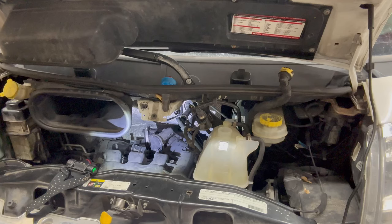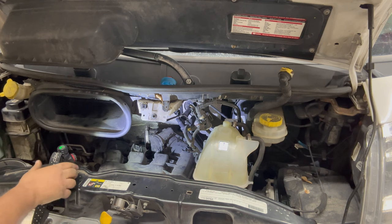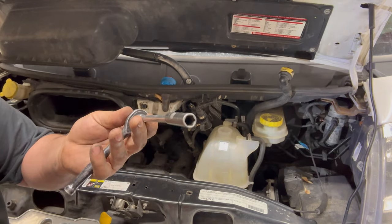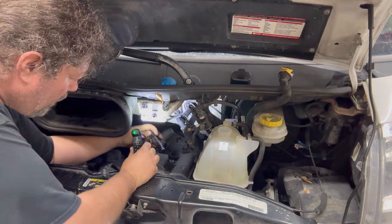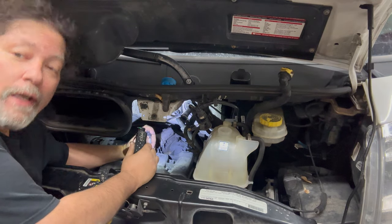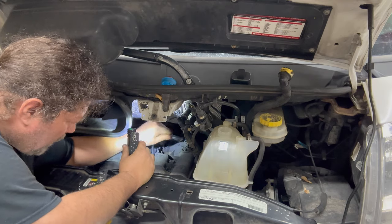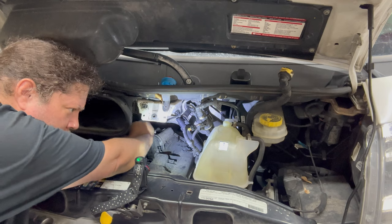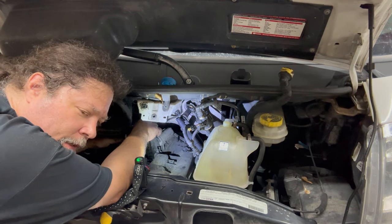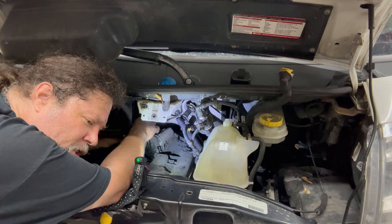It came right out. I'm going to replace these two bolts with brand new ones and also apply some sealant in there to make sure water doesn't get in. These two bolts are a huge problem on this engine — not just on the Pro Master but all the other cars and trucks that have this have an engine cover that directs water away from this problem. The '22, '23 and up all use the G3 Pentastar, which doesn't have this problem because they've redesigned it.